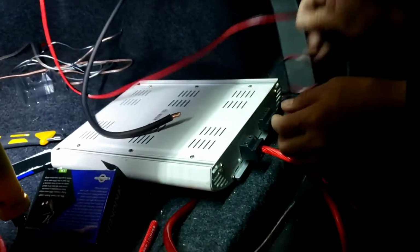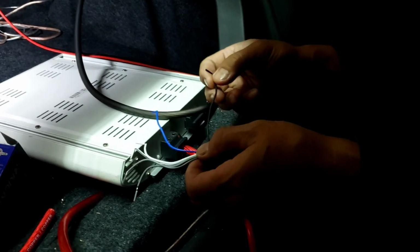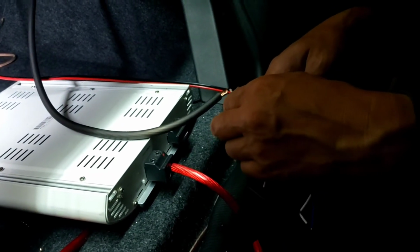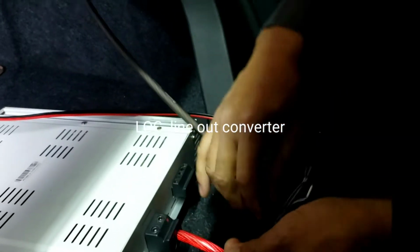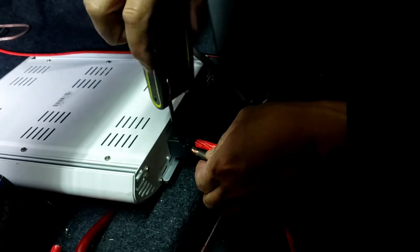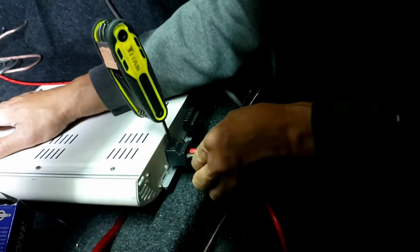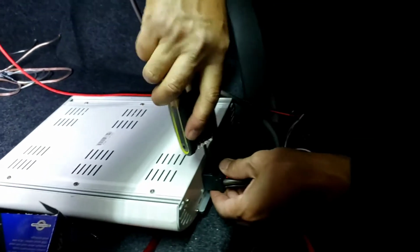Now, as I was talking about earlier, what I got is the speaker wire that I ran earlier from the speakers. I'm gonna get the ground hooked up with the ground right here, because this LOC, which is the high-low converter, wrap it like that. Loosen this part for the ground. Make sure it's in there real good. Not all the way in, because you don't want to hit the plastic or the insulation.